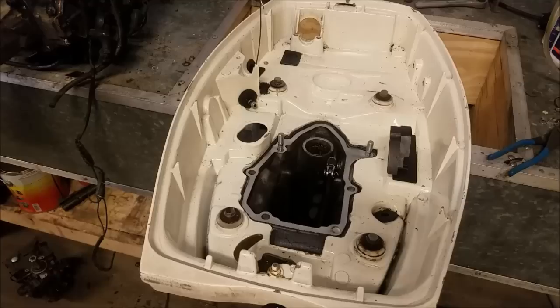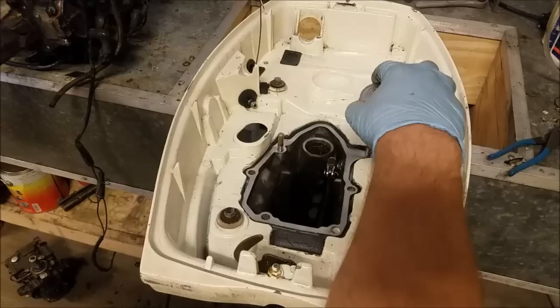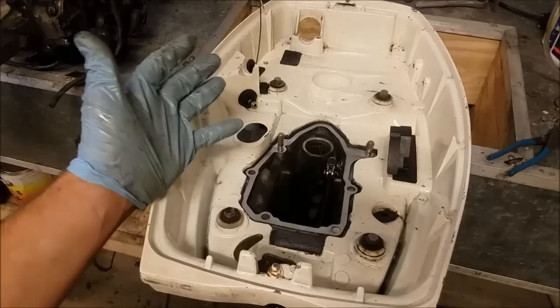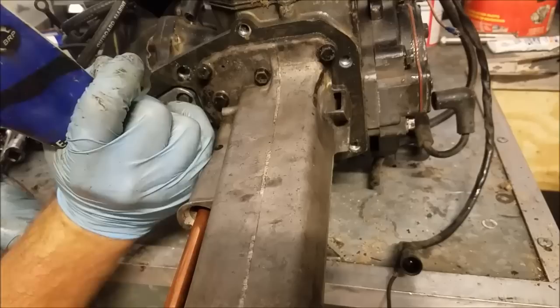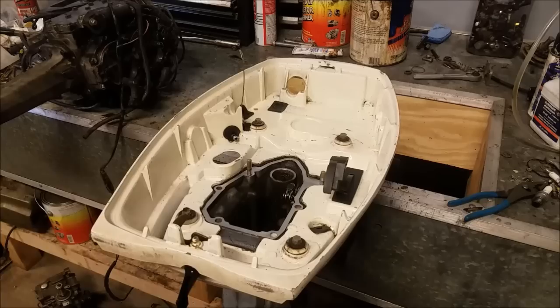Alright, it is time to install the power head back on the housing. These studs are going to be the most annoying part. You're supposed to use blue Loctite on these studs; however, I'd rather use some sealing compound to protect the threads and make sure we can remove the power head again if the time ever comes. Before putting on the power head we're going to want to get some triple guard grease and put it on this o-ring. If there's any damage or you have any concerns with this o-ring, it would be a good idea to replace it.